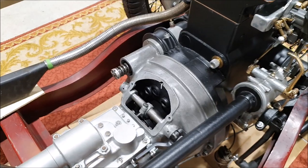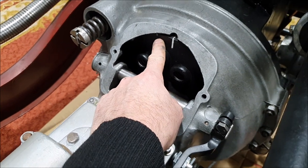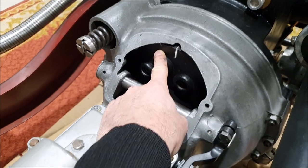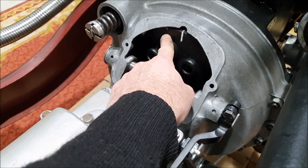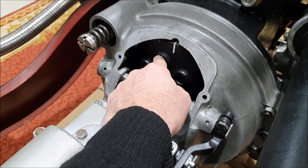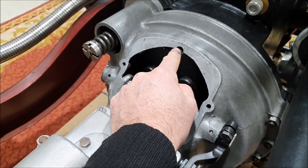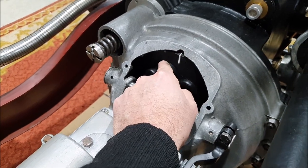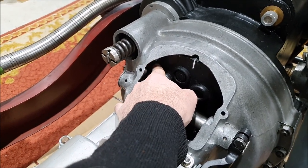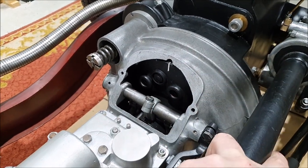What I ended up doing is I measured the diameter of the flywheel, worked out the circumference from the radius, and put little marks on the flywheel with a grease pencil at 10-degree intervals. So if I take the top as being top dead center — this is my TDC mark, there's no actual timing mark, just a little hole you can sort of see through — I've got 10 degrees, 20 degrees, and the first bolt on the clutch cover is effectively 30 degrees. It's all a bit approximate, but it's close enough.